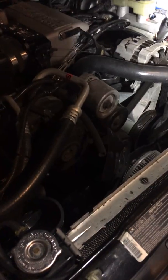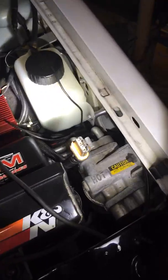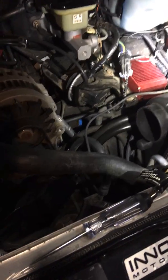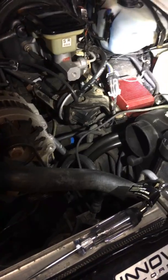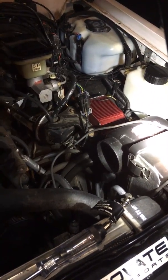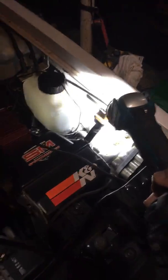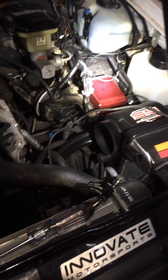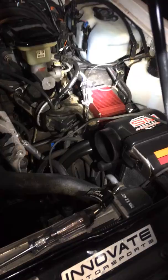I did find a plug from the old ABS right here. I got a nice thick 10 gauge power and ground right there. And to my Kenny Bell booster pump, it's got a 10 gauge power and a 10 gauge ignition on. So I'll tap into that for ignition on, because I'm pretty sure the fans use the power from battery hot. The ignition on is just to, I guess, set off the relay or whatever they use in there, and also for the soft start and soft shutdown. So that's about it. We're going to go from there.